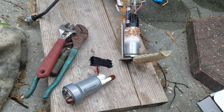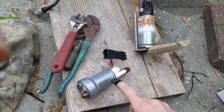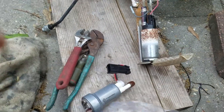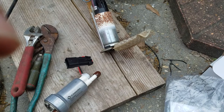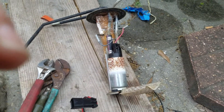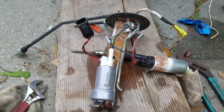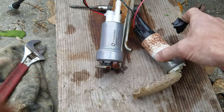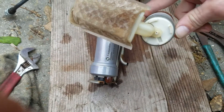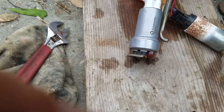I'm going to try to use that same rubber grommet that centers this fuel pump for the new one. I've got a new sock filter and I ordered the modification kit that comes with this pump in hopes that some of it will work with this application. I put it in place with the rubber grommet — one thing I noticed is the rubber grommet that came with the 255 is molded to fit two little tabs, while this one has something a little different, but it seems like it's sitting in there nice and tight.